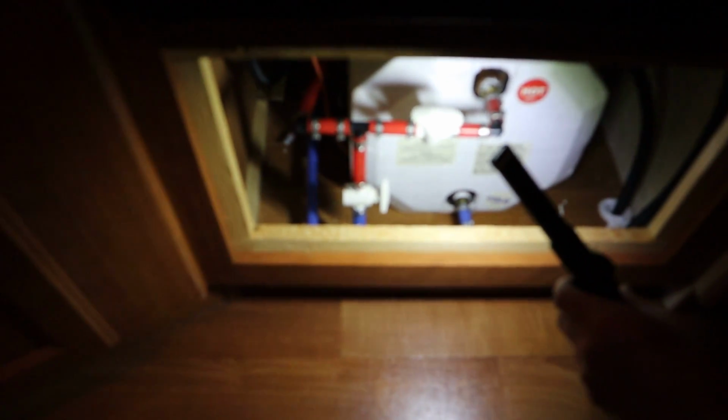But our bypass valve, what's up with that? That'd be open too, right? To bypass, right? Yeah. So let's close that so it does not bypass anymore. Okay, now we are in normal operation. So now we turn the water heater on, it should make hot water, and then he'll be able to use it.